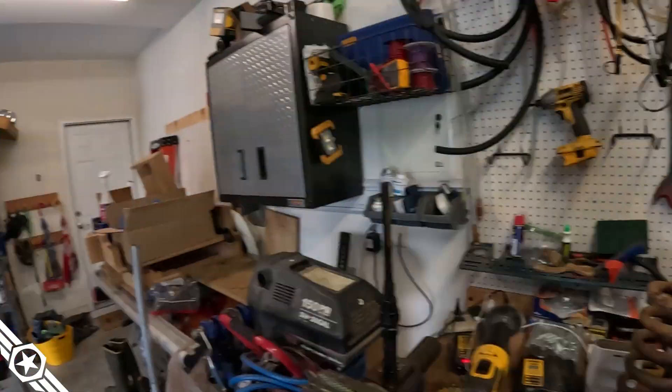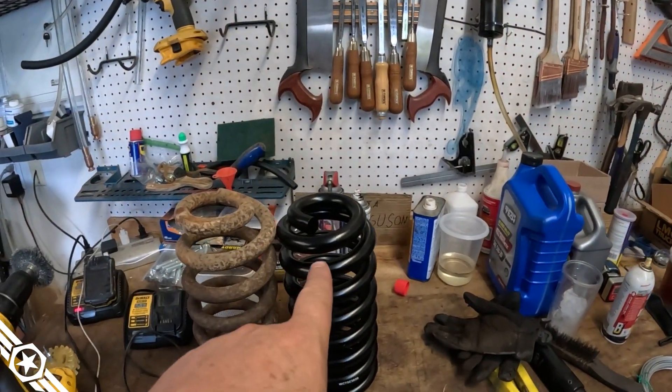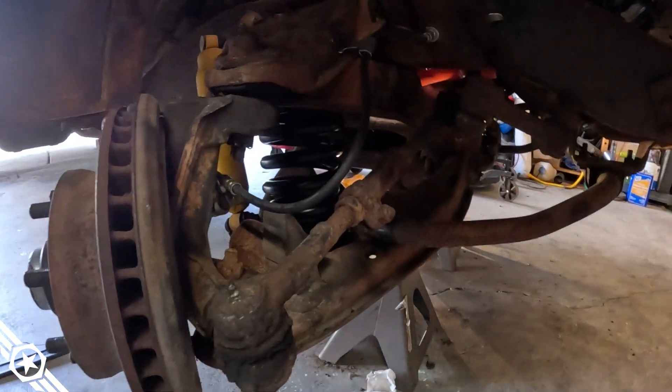I just put the one-inch body lift on the cab. The truck's got exactly a one-degree rake upward in the front — I want it level or slightly raked down. So I've got two-inch coil drop springs for the front from Western Chassis. I've already got one side installed and I'm working on the other. I don't expect a full two-inch drop since the old springs are 50 years old and probably already sagging. If we don't get enough drop, we might have to look at drop spindles.